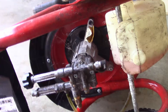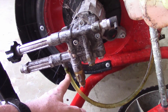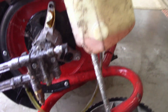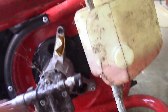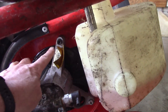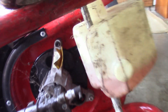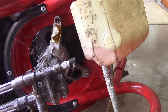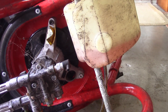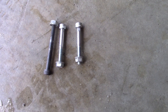Underneath the unit you can see that one line where the tank is — you can put soap or whatever in there and it'll suck it out of that tank, so that's going to need to come off. It's only three bolts — allen head screws, six millimeter — one up here, one down here, and another one over there. You can see that one of them is rusty for some reason while the other two are not. I sprayed some WD-40 on there in case they're seized, and I'll use an allen wrench to get those off.